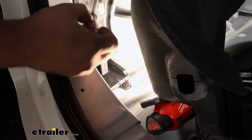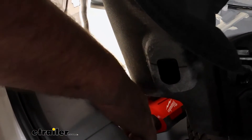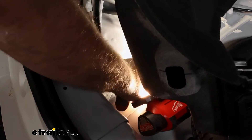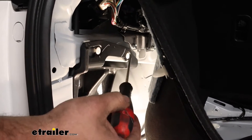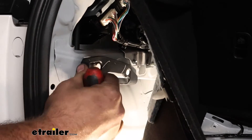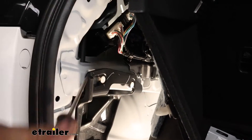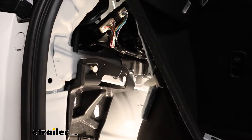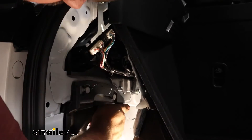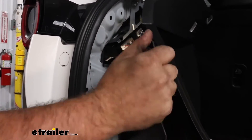There's also a plastic piece here with a plastic pushpin down by the floorboard, so get this pried up as well. This whole black plastic section is going to come out. You can see this one slides to unhinge, and then this needs to slide up. You can push it and work it out, or if needed, pry on the white plastic tab underneath and get that to separate. Either way, be careful — you don't want to break these. Just make sure you have eyes on both of those clips, and set this aside for now.